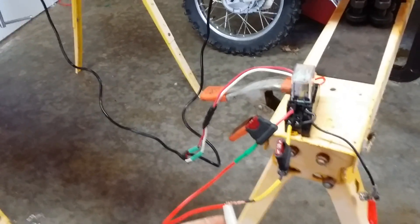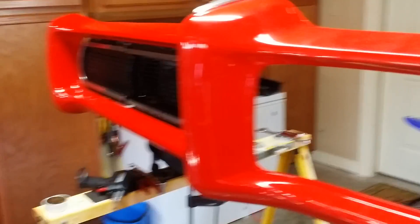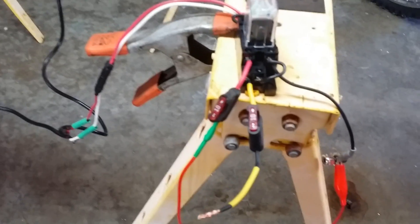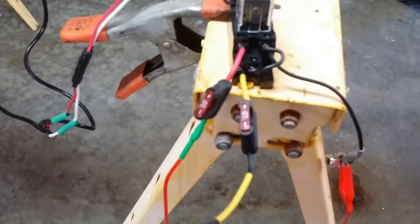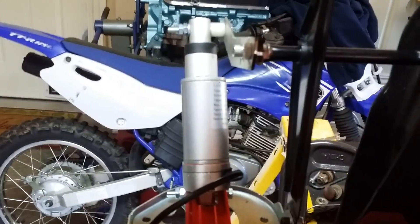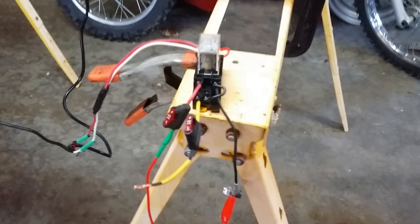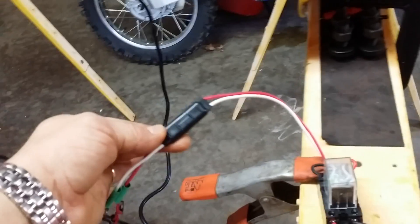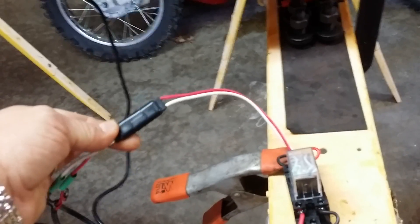All in all, it works very well. The hardest thing is probably the wiring — there are absolutely no plans for any of this wiring out there. I fused everything at 10 amps; you don't need any more than that, because these actuators are rated to push like 300 pounds. These doors can't weigh more than three. Wiring to the car is basically a four-wire system: one ground to the chassis, one to the headlights, one to the battery, and a single plug to the actuator.